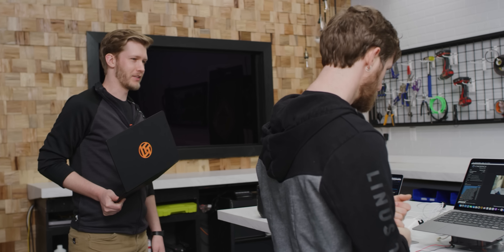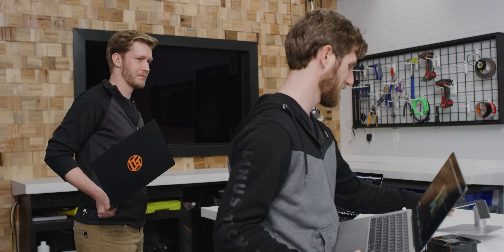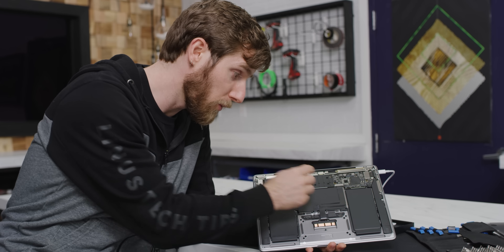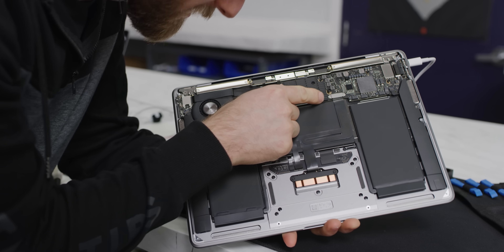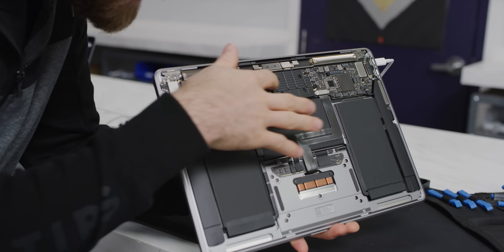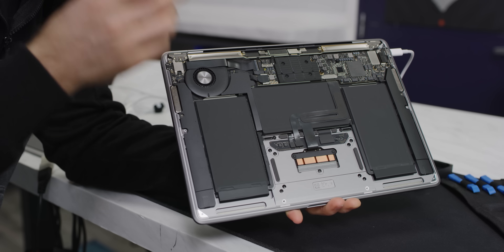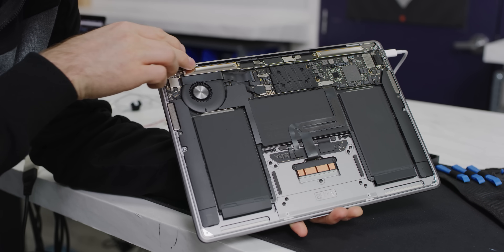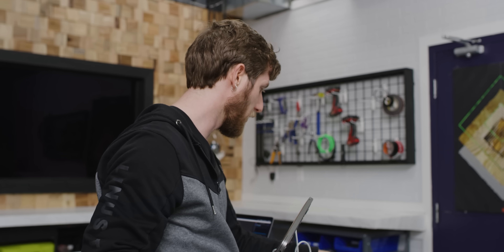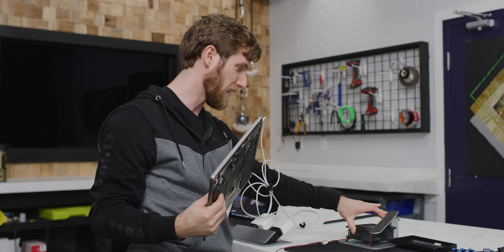What's test number two? Fan with no bottom. This is kind of the test for — if they just put a fan in there, how good would it perform? With the unit open, here's the CPU right under this tiny little heat sink — some little folded metal fins over it. And here's the fan that Apple put in the laptop. They just didn't bother to have the fan draw air over the heat sink to cool the CPU before exhausting it. Nobody has offered a clear and believable explanation for why they would have done this. They put the heat sink and fan in there — they just didn't bring them together.